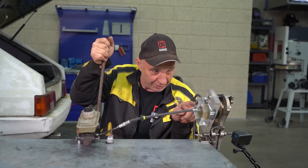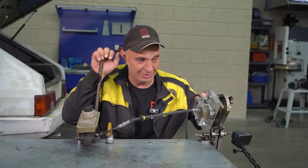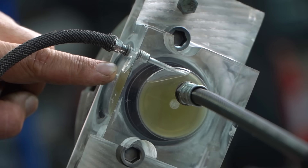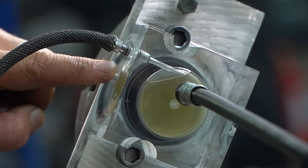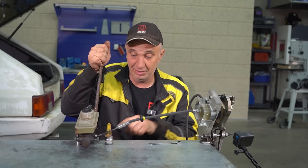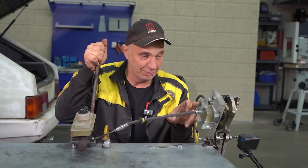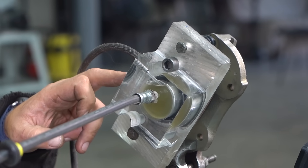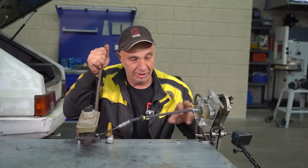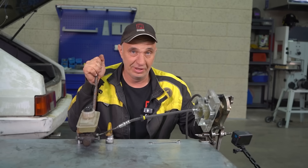You'll notice that we still have some air in there — you can clearly see it. We got a very good view of the air bubble that forms when the brakes haven't been properly bled. Now, that doesn't seem like a whole lot of air, but actually it's quite a bit. The brake pedal is released, and this is what mushy brakes look like. Now we press it — that prompts the piston inside of the master cylinder to push brake fluid into this area. But since we got air in there, the air just gets squeezed. You can see by how much it contracts, and that correlates to massive pedal travel, all while not translating to pressure exerted by the brake pads.